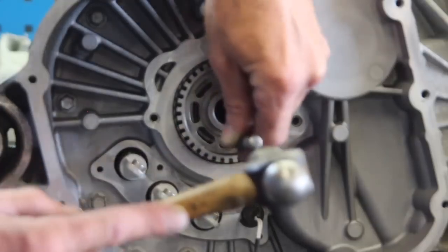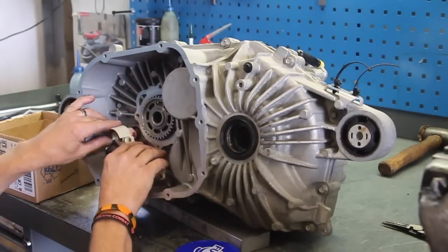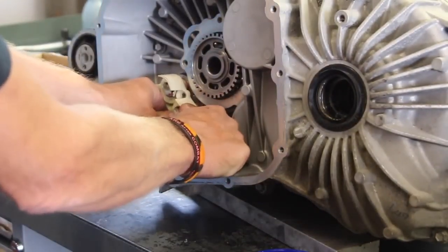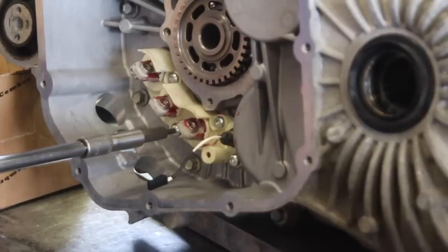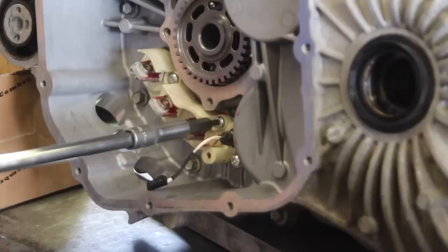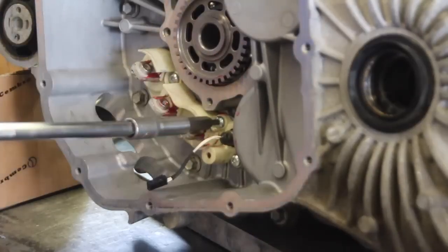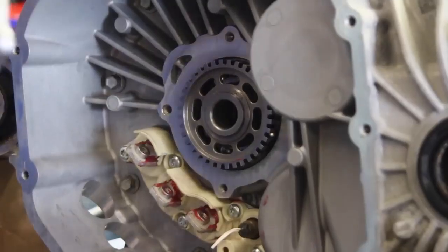The bearing we put on beneath that encoder — when you're taking it apart you don't need to remove it at that point; you can take everything apart and then remove it afterwards. Here we're putting the covers back on, which have O-rings and seals in there to stop the gearbox oil coming into the inverter side, so make sure that's very clean and put some rubber lube on them — that's the red stuff you can see — and then tighten that back down. All torque settings will be in the description. Then put the encoder cover back on.